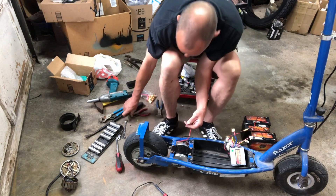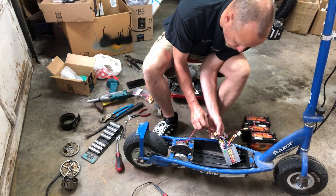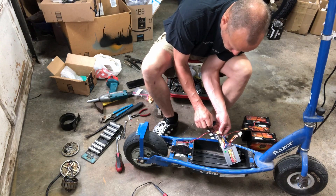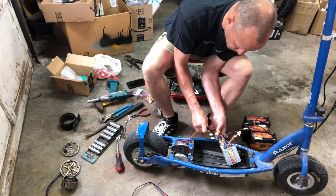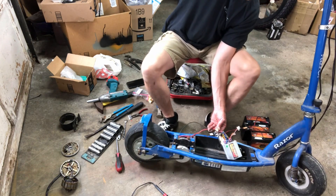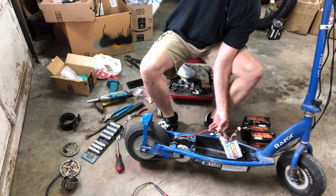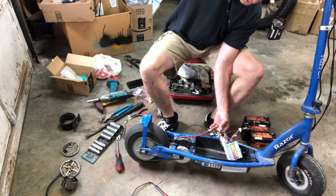The stock output of the speed controller for the motor is blue and yellow, and you have to test the motor to see which is positive and negative so the motor turns the correct direction. I put red to the blue and black to the yellow. Turning on the key — we've got 39.4 volts. Picking up the rear wheel, hitting the throttle — it turns forward! This is going to be so good.